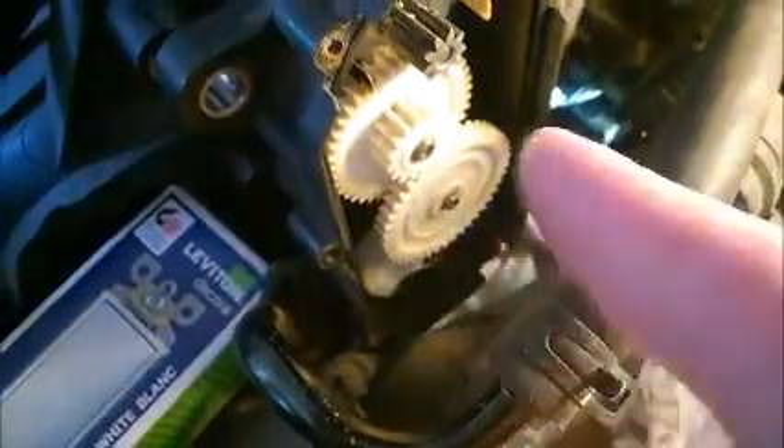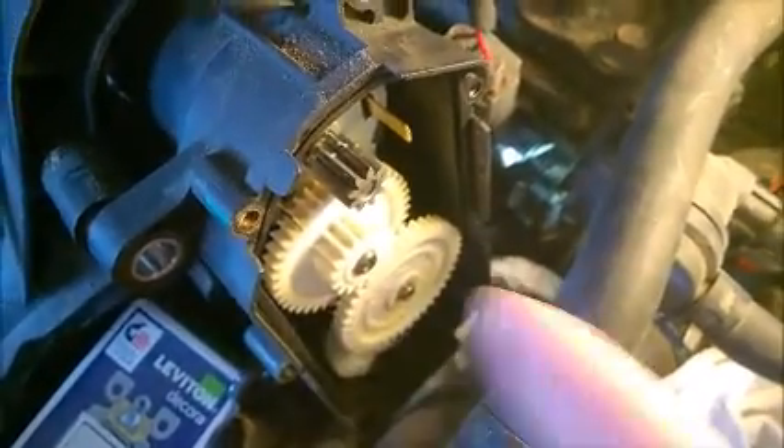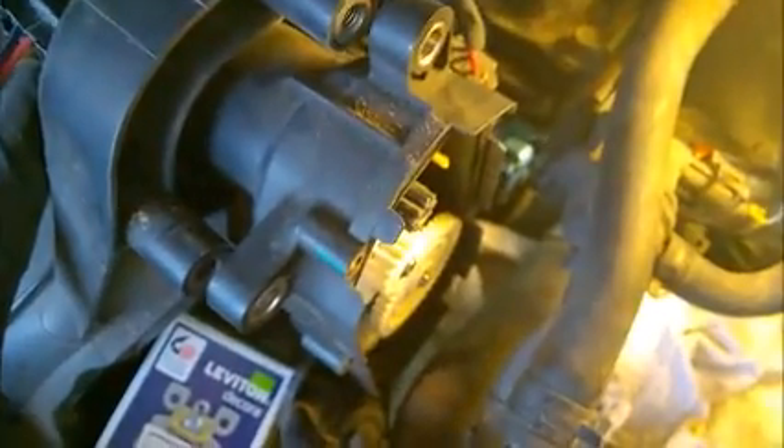First you may want to check the gears, but removing the cover is more difficult, so try to wiggle like this first. My VCM did not get the clicking sound. On a Volvo - my older car - and Hyundai, it diagnoses this also by hearing a clicking sound. That clicking sound means the gears cannot rotate and something is really stuck, with the metal gear forcing on the plastic one. When you hear that clicking, maybe it's already stripped. But if you don't hear clicking and still have normal engine power, maybe just keep the cover in place, don't remove it - just wiggle those things and try to make them move freely.